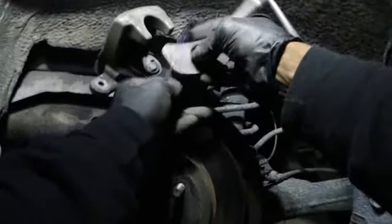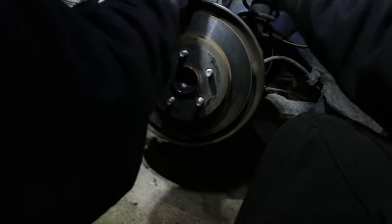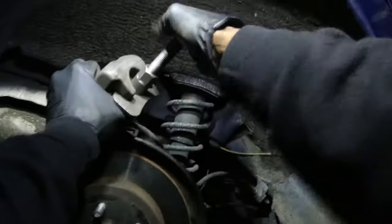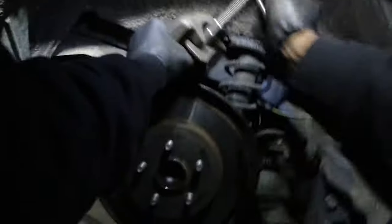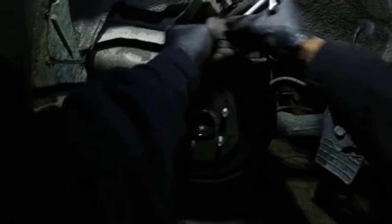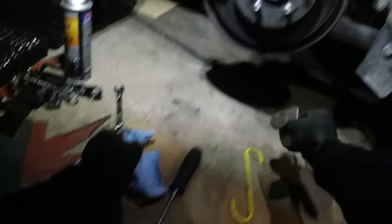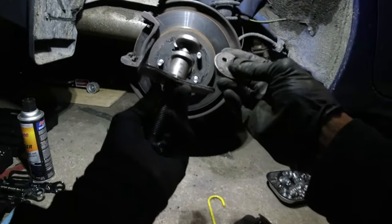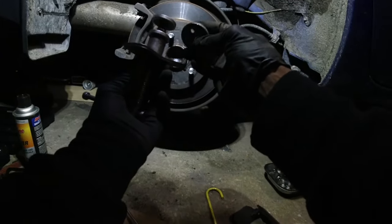Boot is nice and even. Turn clockwise, put it in so that the teeth line up with the piston. Turn it counterclockwise to bring it nice and flush against the fingers of the caliper bracket. Just turn it until it bottoms out. Clockwise to release. That's the tedious part of this whole thing. It's called a piston. This is called a brake caliper wind back tool — I just rented one from AutoZone for like 65 bucks, and I'll get my money back when I return the tool.